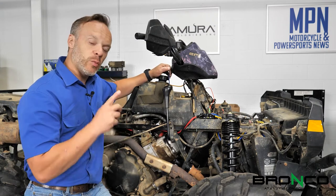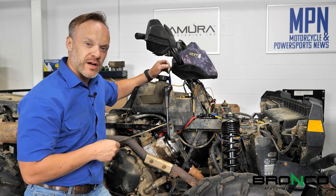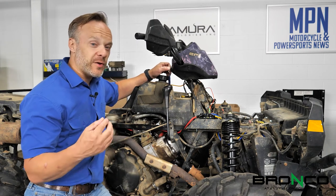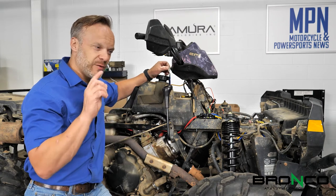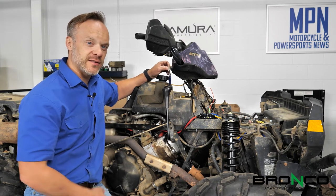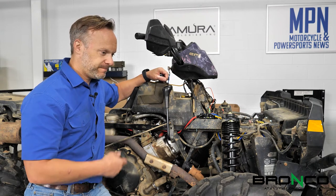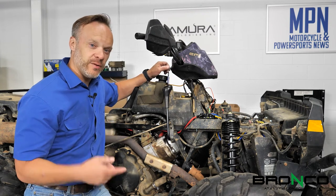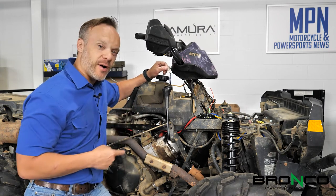What you'll do is turn the key on. When you turn the key on, you'll probably hear the fuel pump kick on. Or if you don't hear it kick on, that's a pretty good sign that it may be bad. But we need to diagnose that further. So let's give this a listen and see what we got. It should have cycled by now, and I didn't hear anything — so that tells me it's probably not working.